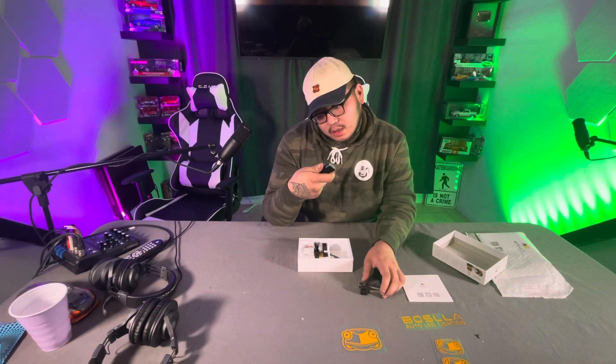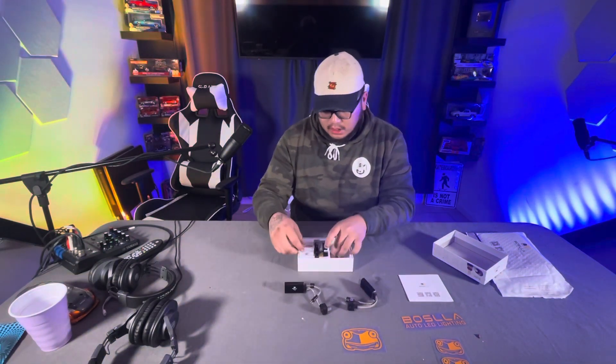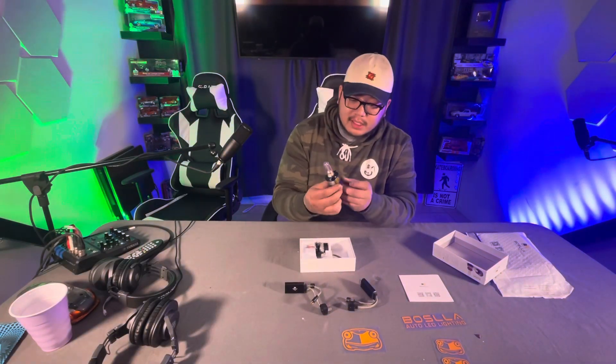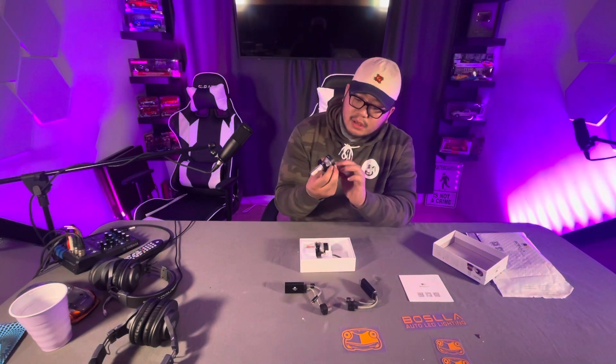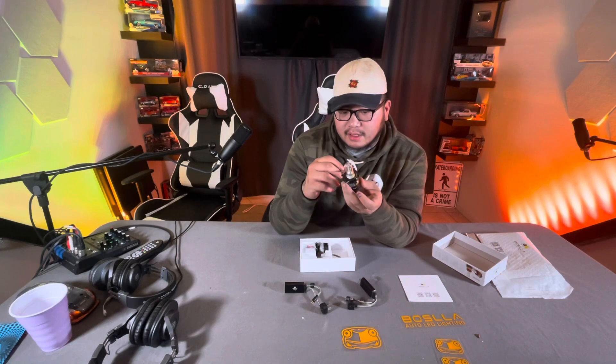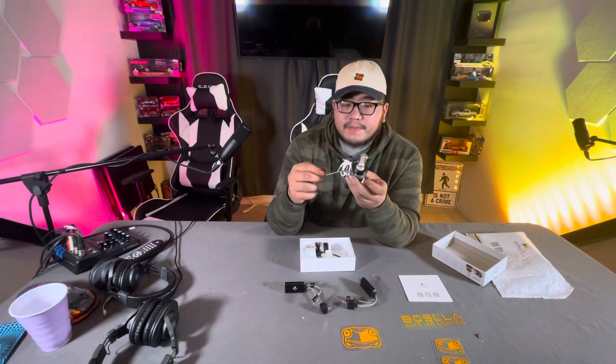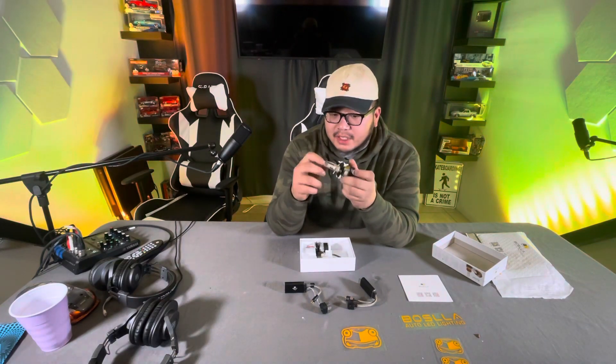They come with a ballast right here. I have an H4, so this is the H4 ballast. You have the connector to the car, and you have the connector to the bulbs themselves, and there's obviously two of them. Let's take out the bulbs themselves — nice silver and gold. On the back it has the B for the company. It's a nice feature because it covers the fan, so if you're running these constantly they'll always be nice and cooled down. You don't have to worry about overheating them. For this model it worked for my car — H4. And they have a glass protective piece — it says 'remove glass', so once you install it you've got to remove it.